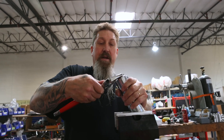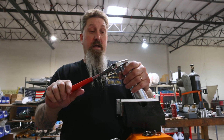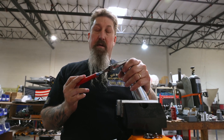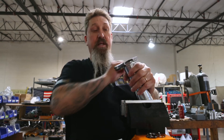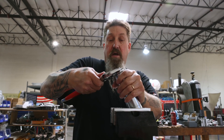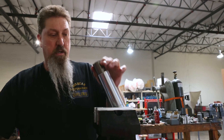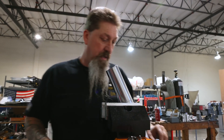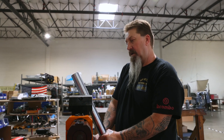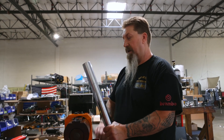The spring in here is actually preloaded pretty healthy. If you don't grip this and control that spring, it'll make you look like a hillbilly who knocked your teeth out. By gripping that spring, I'm squeezing it against the side walls of that upper tube. Now I'm going to release this slowly — I can feel the lower leg coming up — and there we go.